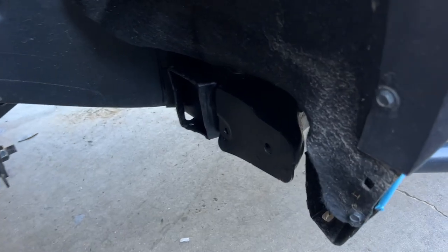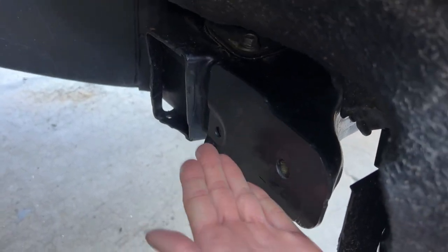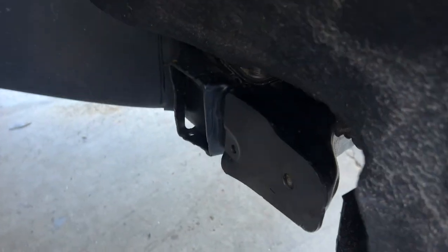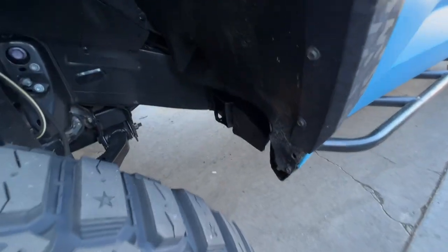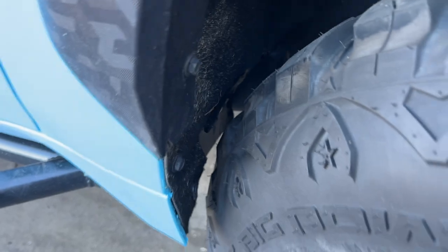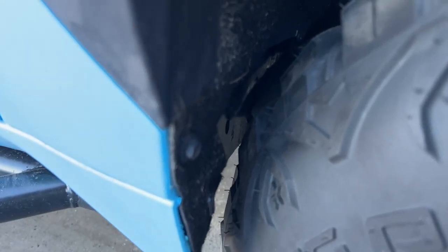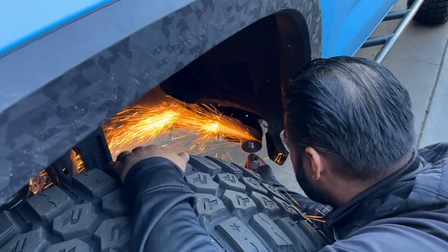Right now we're talking about doing a cut on this crash bar right here — cutting it back a little bit. Either shaving a piece off the bottom, or cutting the whole thing back closer toward the cab and then mounting a new plate on the front so it still functions as a crash bar. This side rubs a lot worse, and it's pretty apparent that this whole section sticks out further than the other side, which is why this side rubs and the passenger side doesn't. The passenger side is further back toward the cab. On totally flat ground the passenger side is okay, but this driver's side definitely needs trimming.